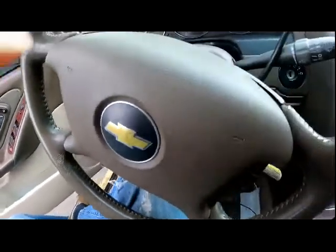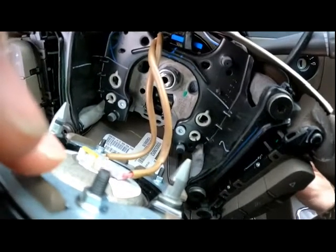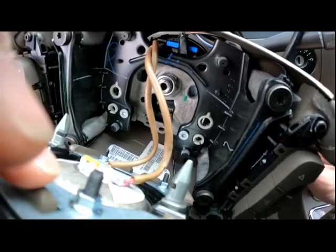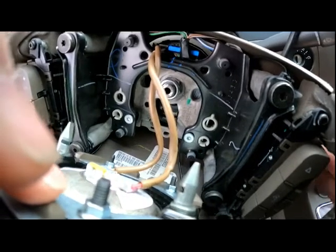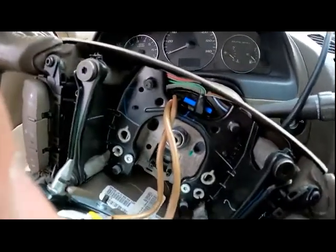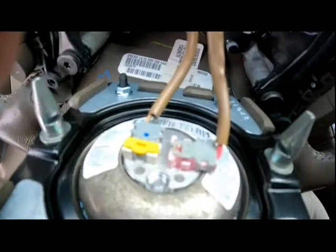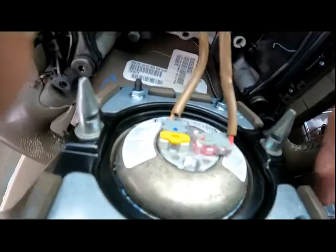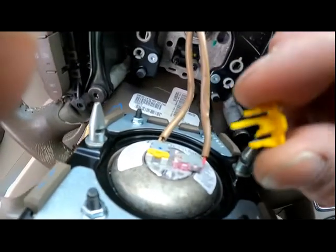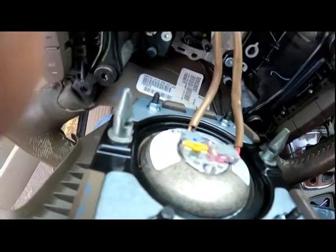To pop this thing out, you're going to be pushing against a little clip inside — go about two and a half inches in and push the clip. You can see it moving. Do both sides and it pops right out. We need to inspect the wiring harness for anything obvious, but typically there are these little safety retainer clips in the back. Pull it out — the right side clip is broken.